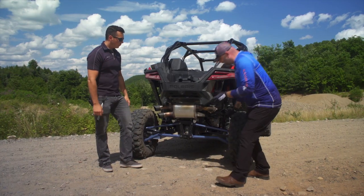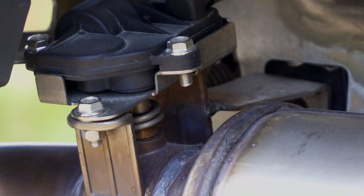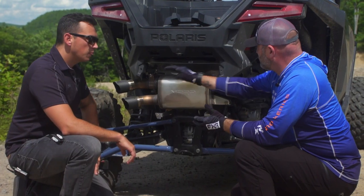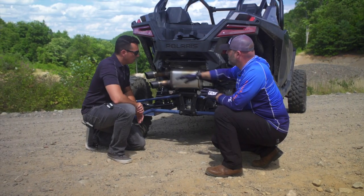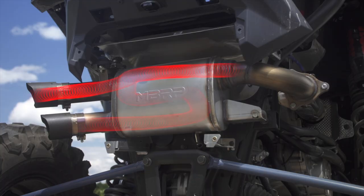Let's get down here and talk about how this works. We see what I'll call a butterfly valve — you call it an exhaust valve — right here, with a baffle system that flips open and closed. It's at the exit of the exhaust. When the valve is closed, the exhaust snakes through and exits on the bottom, so it only exits out of one tip. When you have it open, it's much more free-flowing through the top as well.